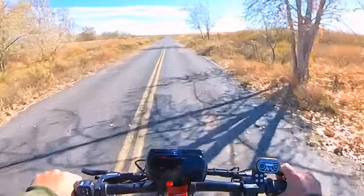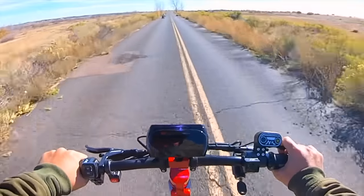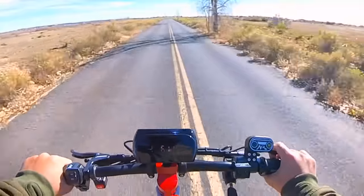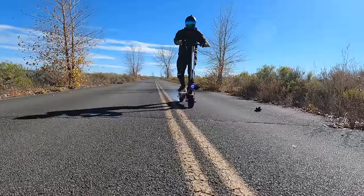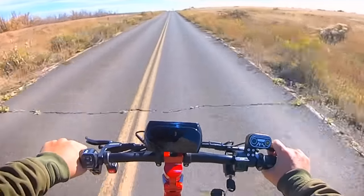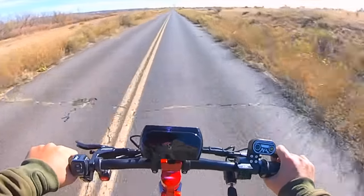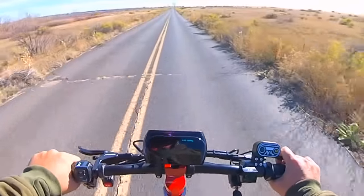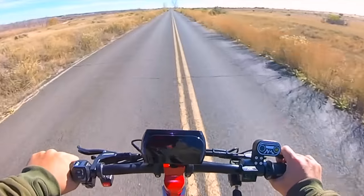The road is clear and we're ready to go. Really stable — that's a bump. 56 kilometers... 58... 63 kilometers... 65 on the display. I'm impressed — it's an overachiever. I saw it hit 43 miles per hour and the stated top speed is only 40 miles per hour. We went 0 to 10 mph in 2.97 seconds, 0 to 20 in 5.59 seconds, 0 to 30 in 10.49 seconds, then it slows a bit — 0 to 40 mph was 22.19 seconds, and 0 to 43 mph took 28.87 seconds. It kept gaining speed — the display reads 66 kilometers and is actually understating the top speed, which is impressive.